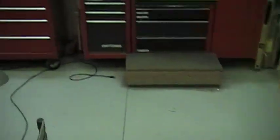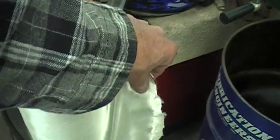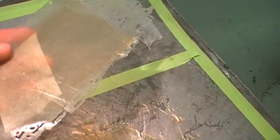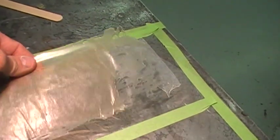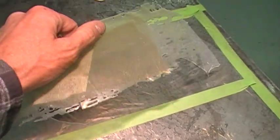I've been doing a little bit of research on this — I'm going to overlay fiberglass over the cab. I got this mat given to me several years ago and it's really a thin mil of fiberglass. What I do like about it is it is formable. It's way too thin as a single layer, and a double layer is better. I think what I'm going to do is make my foundation out of three wet layers: resin, glass, resin, glass, resin, glass. That will give me a good base foundation for coming back and abrading it and putting something more substantial behind it after I get the initial shape I want.